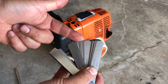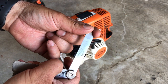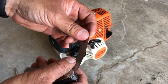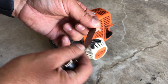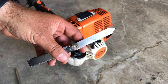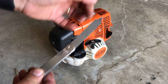The other thing to note is that because of where the feeler gauge has to go in, you need a bit of a point on it. This particular set comes with rounded ends in varying sizes, so I took the size I needed and ground down the two sides with a grinder to give it a point. It can bend because it is so thin. Stihl actually sells a kit for adjusting their valves that comes with a new valve cover gasket, seal, and feeler gauge, but I just reuse the existing seal and use my own feeler gauge.